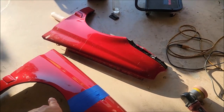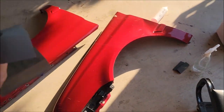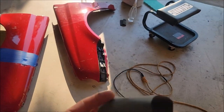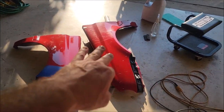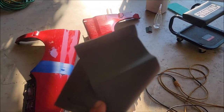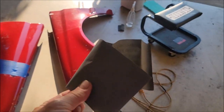I have some 2500 grit sandpaper right here. I already did a test section on the other fender with 2000 grit and it worked great, but I don't want to work that hard to get sanding scratches out for this demo. So I'm going to lighten it up a little with 2500 grit. I'm going to wipe that panel down — it's got fiberglass dust on it — so it's free of random debris and contaminants, and then we're going to sand it with this 2500 grit wet-or-dry Diablo silicon carbide waterproof abrasive paper.